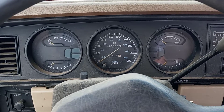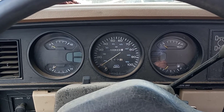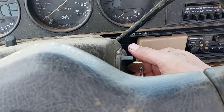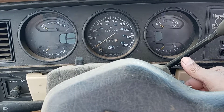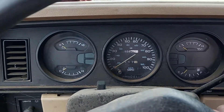What's up YouTube? It's got a 1993 Dodge Power Ram 150. Here's how you read the codes. You're gonna have to switch the key to the on position. You're gonna go on, off, on, off, on, and then you're gonna get flashes at the check engine light. I'll show you guys now.